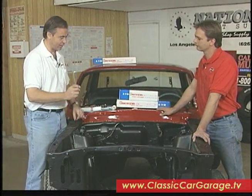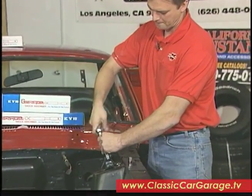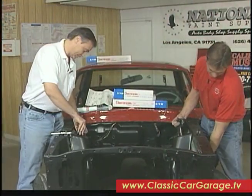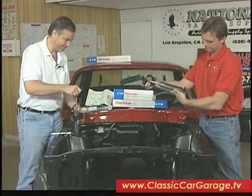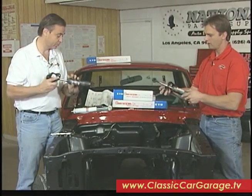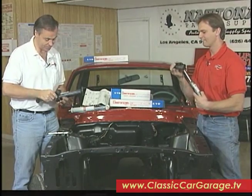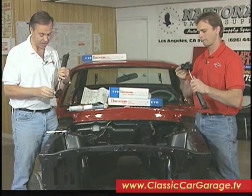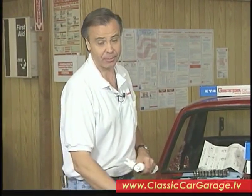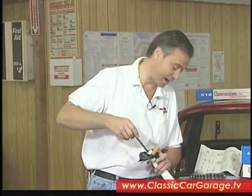I'm going to hand you this socket, grab one on this side — you do that one, I'll do this one. Let's pull them out and lift the old ones out. Take a look at that — these were Monroes. These are not the original shock absorbers, but nevertheless they did serve their purpose. So we'll simply separate the cap from the shock absorbers and then drop in the new ones. It's really quite simple to put your new gas shocks in — just simply reverse the process. Start by putting your cap over the shock like this, and then just drop it down in there.